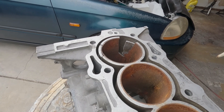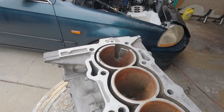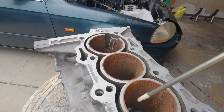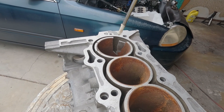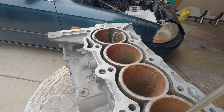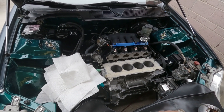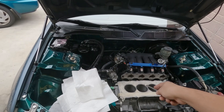He said, think about how much that iron sleeve will heat up and how much heat has to be transferred to your water coolant. Versus the dry sleeve — on a dry sleeve nothing is altered, it stays the same. To handle the heat that the massive iron wet sleeve transfers to the coolant, you must have a good radiator — the right size — and a good radiator fan. Also make sure you have a way of extracting all that heat out of your engine bay.